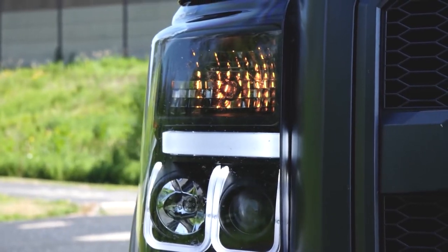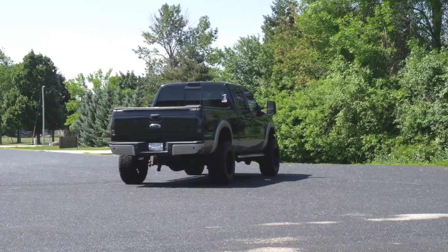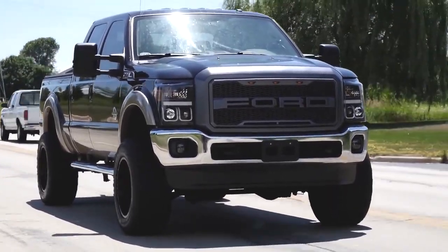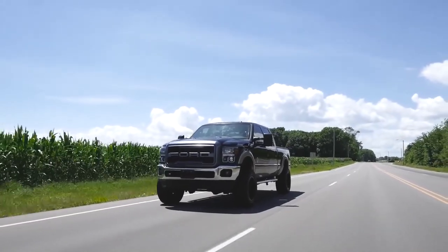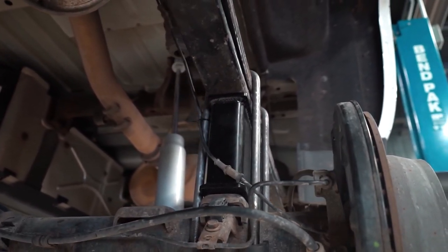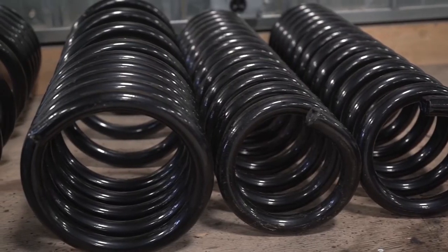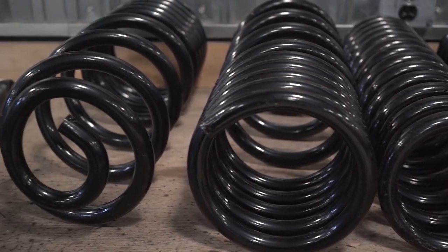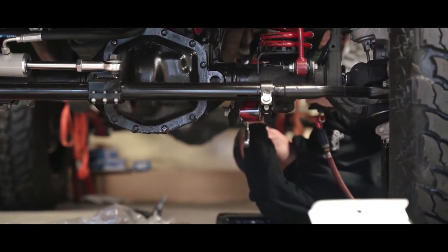One of the most important things to consider when lifting a solid axle truck is keeping the axle centered. A unique characteristic of a solid front axle is that it's connected to the frame by control arms or radius arms — unless you've got an older truck, then you might have leaf springs. All of these methods cause the axle to travel through its range of motion in an arch, meaning the axle will move forwards and backwards when traveling up and down. When it comes to a coil-sprung truck with control arms or radius arms, when the axle is pushed down — like how it would be from a lift kit — it will actually want to pull that axle backwards towards the cab due to the arch swing of the arms.